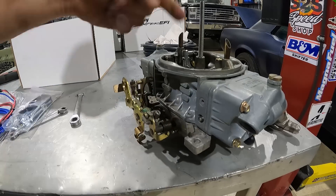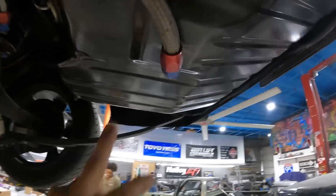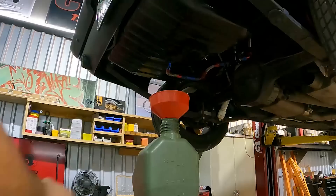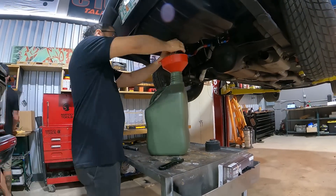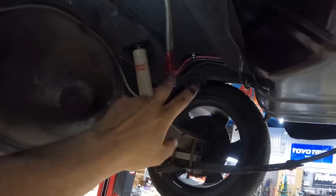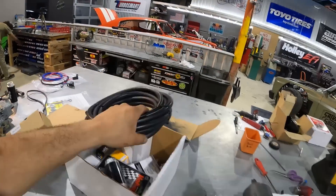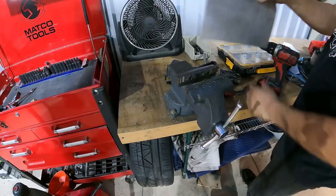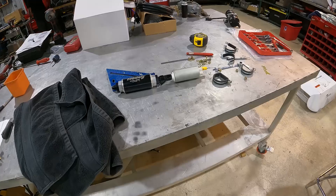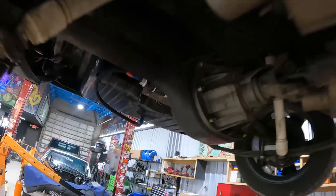This little ball-end clip connects to the throttle. I'll probably need the large mounting stud for the air cleaner. The unit is installed on top of the intake manifold. Now I'm focusing on the fuel system — we bought a master kit that comes with an inline fuel pump. This car already has a sump tank which is awesome. I pulled out the old pump and filter assembly, and I'm using a 100-micron pre-pump filter. I'm going to keep the existing feed line and only run a full return line using the supplied EFI hose from the master kit.